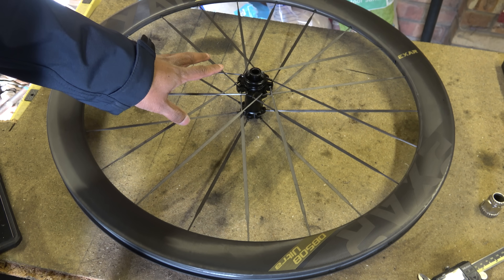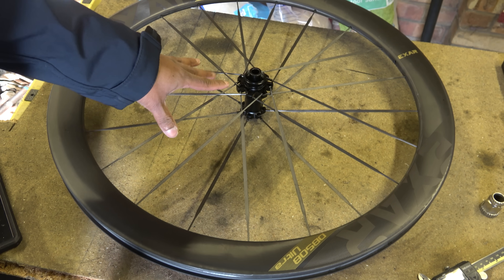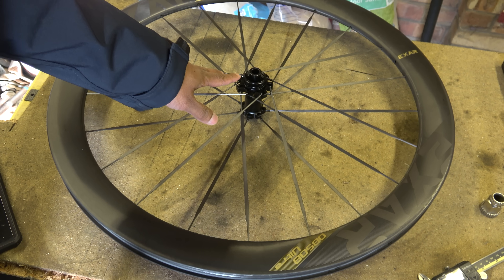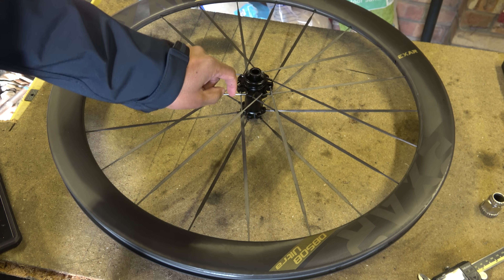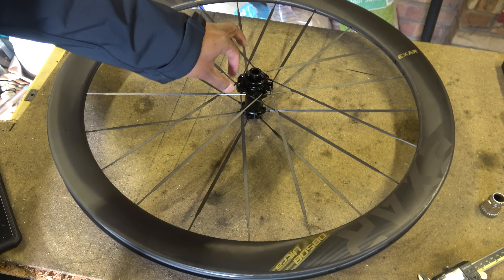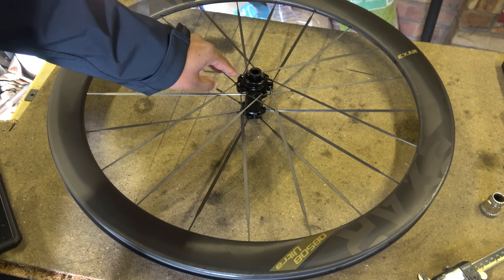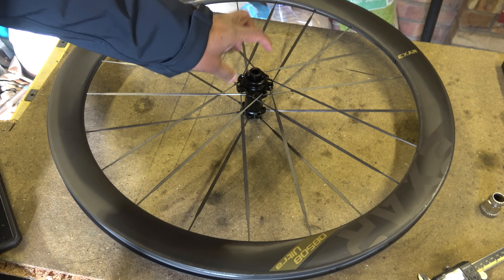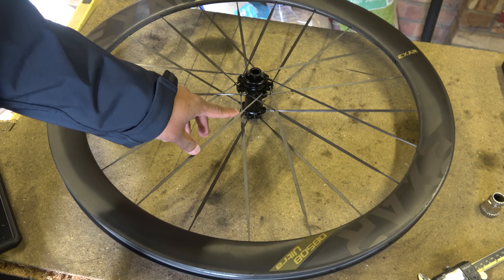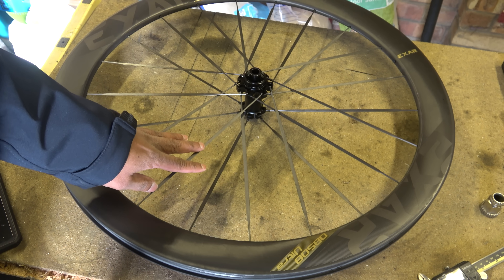The front hub is pretty much standard run-of-the-mill. It's not shrouded, which for an aero wheelset at this level you'd probably expect, but nonetheless it's still of decent quality. We've got 15267 bearings on both sides. The disc mount is full — some only have every fourth spline engaged, but this one's full with a slight taper so when you pull it on and off it bites and doesn't rock. The lacing is cross-laced on the disc brake side, so the non-drive side, so braking load goes through that side.